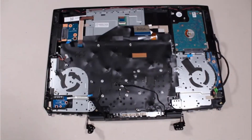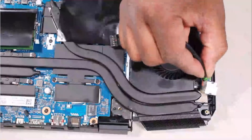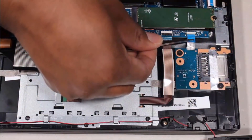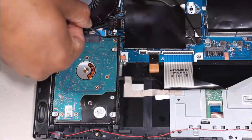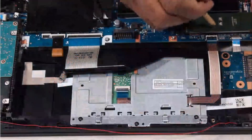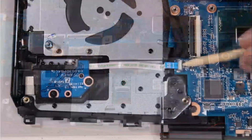Replacement. Note: When installing a new top cover, remove the following from the old top cover and install on the new top cover: power connector cable, USB board, card reader board, hard disk drive assembly, speakers, touchpad board, and power button board.